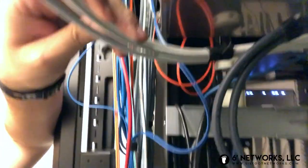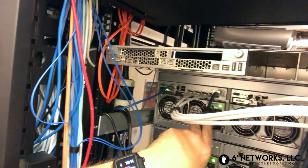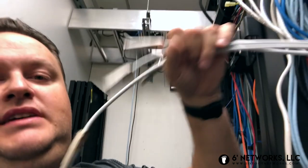The good thing about this is that a lot of the storage is actually redundant. It has redundant connections that go into the storage array. You can see there are four connectors here that ultimately connect the storage to the fiber channel fabric. There are several servers here that I've already replaced the fiber channel back end with optical cables, and that's how I knew the performance increased a little bit. Here are the cables that came out of those ports, which I'll remove at some point.